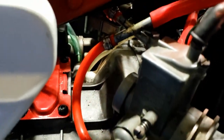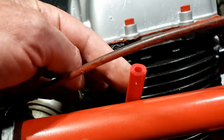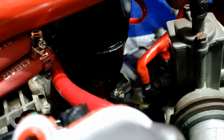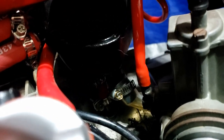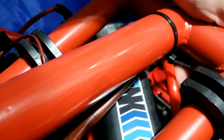There's the crossover piece, and then we've got one coming up to the petcock here and one going across to the petcock on the other side. That looks about right. The only issue is on this side — as you can see it's kind of collapsing because of that angle. That will be a fuel starvation issue, so we need to pull it up and strap it on somewhere up here to keep that nice and straight.